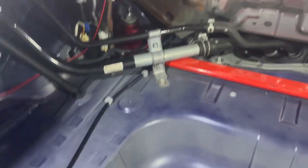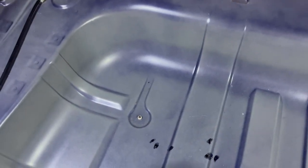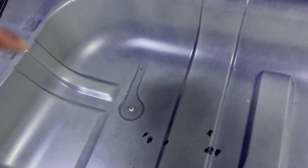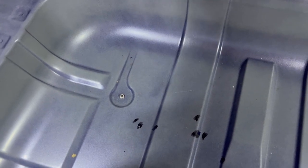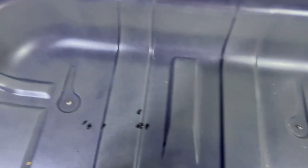The areas you want to focus on are large surfaces that have very little ribbing — those ridges and grooves stamped into the sheet metal. The reason is that ribbing reinforces the metal, making the sheet metal stiffer and harder to bend. If it's stiffer, it vibrates less, and if it vibrates less, it transfers less sound energy.